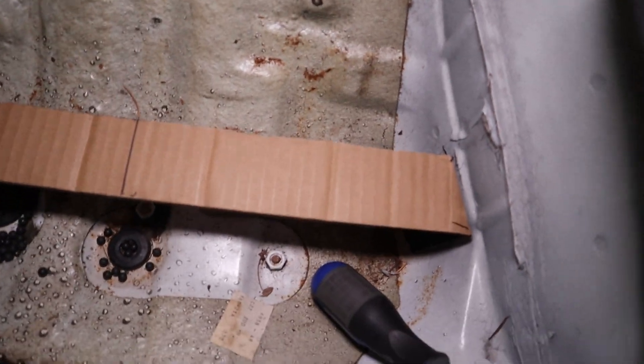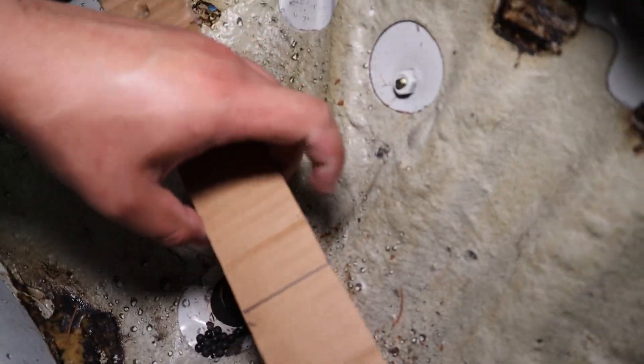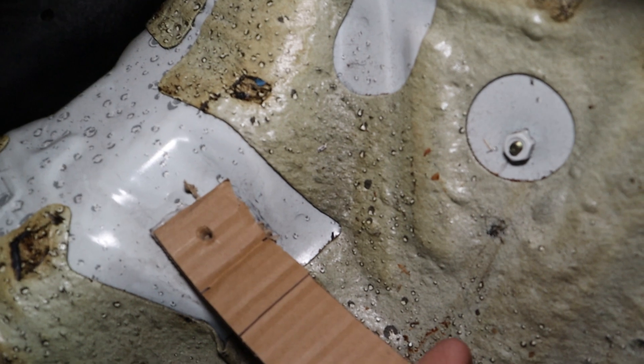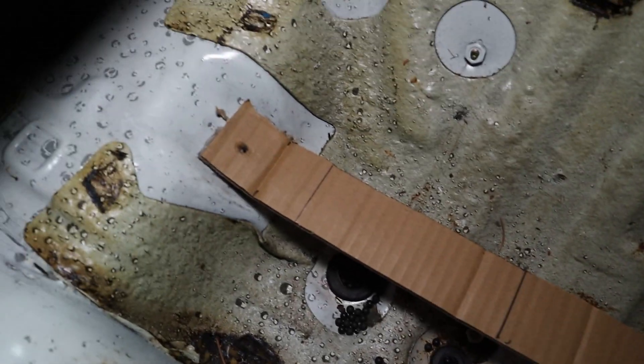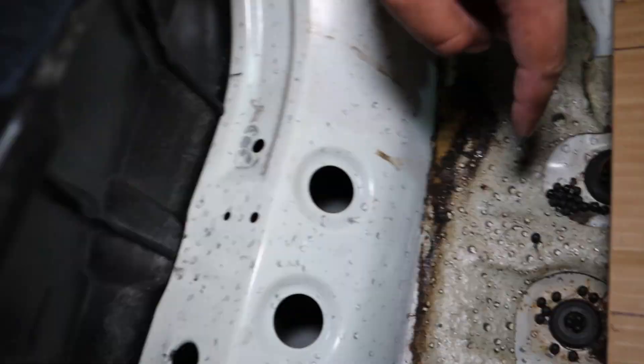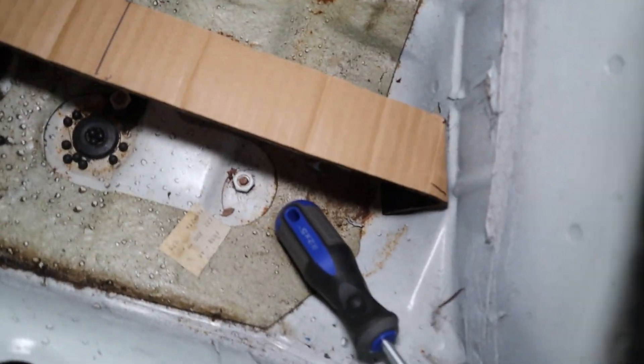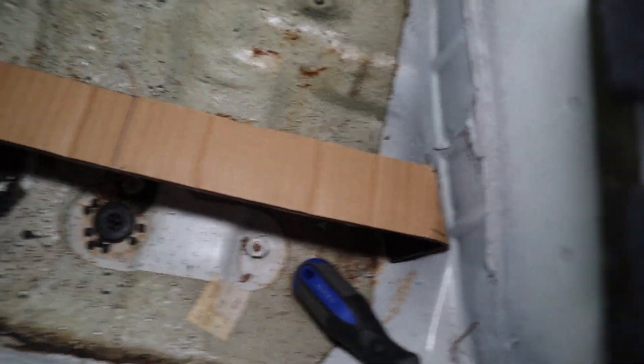A few minutes later I've got this little piece of cardboard acting as my mock-up for the battery mount. I'm going to be bolting into the stock seat belt mounts right here and right there — just a bar going straight across bolting into those two. I'm also thinking about bracing to this front piece, having a little strap, and possibly using those two bolt holes. I like where this is at, so I'm going to draw this up in CAD and get it made out of metal.